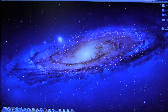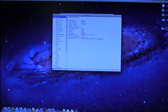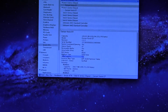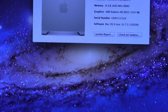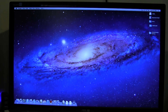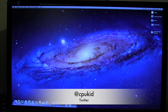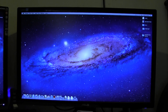Before this video ends I want to mention that I installed trim enabler from MultiBeast and restarted - trim is enabled on these Corsair Force GT solid states, so the life of these drives should not be affected. That's pretty much all there is to running a RAID 0 on a Hackintosh. It's not too hard but from system to system you may run into some weird things. I'm at cpukid on Twitter if you have any questions. I hope you enjoyed this video - give it a thumbs up and don't be afraid to request other videos. Thanks for watching!